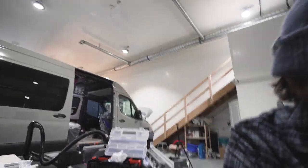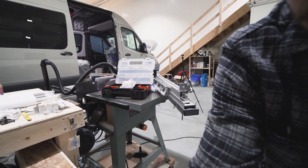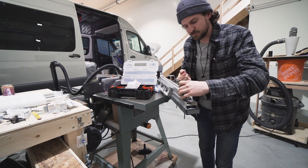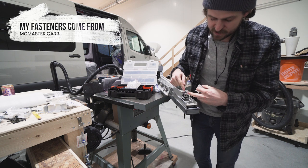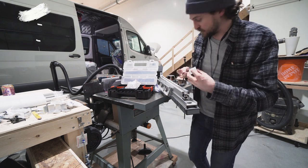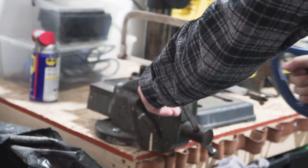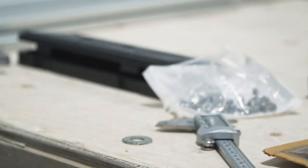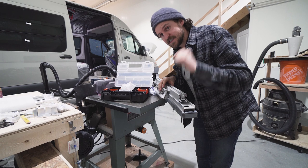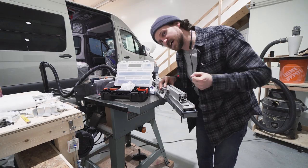So it works. So far, because I didn't buy any of the right size, which is really dependent on the thickness of angle you're using and the two different profiles. This is the 40 series, the 30 series is different. I have to cut every bolt. That being said, I did measure with a caliper, dropped it in there, and it looks like 14 mil bolts will work for both the 40 and 30. So I ordered some of those, but right now, cut, cut, cut, cut.